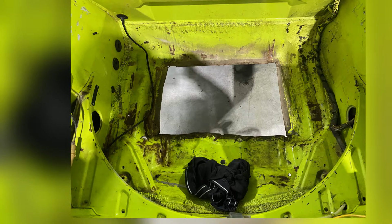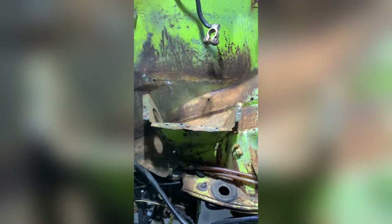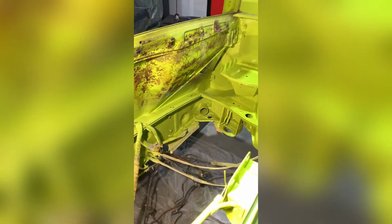We welded in a new front floor pan because previously there was an air conditioning unit which we removed, and we also welded in a new battery tray. After the bodywork was done, we painted the engine bay ourselves with spray cans of primer and 2-component Ravenna green paint. This because our plan was to finish the engine bay so we could drive the car to the paint shop and not take the engine out again.